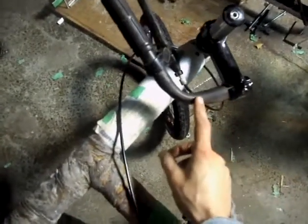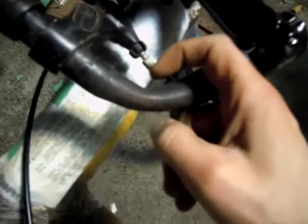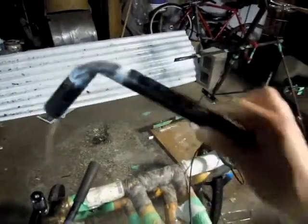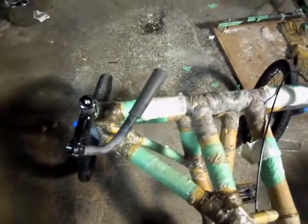I took a regular mountain bike handlebar and I filled it with sand — packed sand in really tight — and then just took a propane torch and heated it up, bent it over, heated it up a little bit more, bent it over. Tried to avoid creases and sharp corners, like this one here. So this is one mountain bike handlebar that's bent and then chopped in half, and then I've squeezed it into the clamp — the stem clamp.